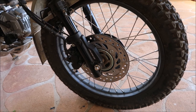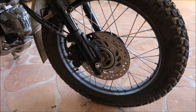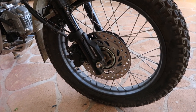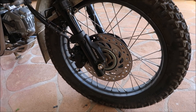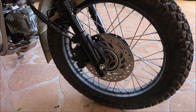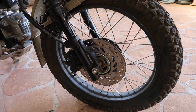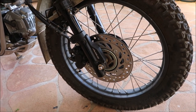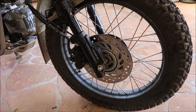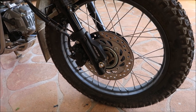So as far as things go, I've got two choices at the moment. First one would be to pull the wheel, take it down, and possibly get a new tube fitted - that'd be the easier and safer way out. Or the second option is I can try this Slime product for tube tires and see how that performs, because it's only a very slow leak. It might even be a slightly pinched tube when the new tube was fitted.